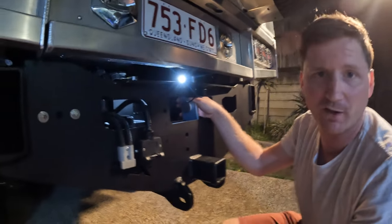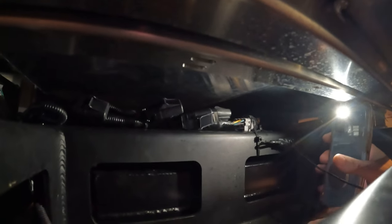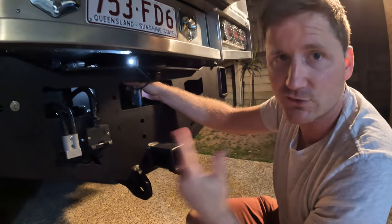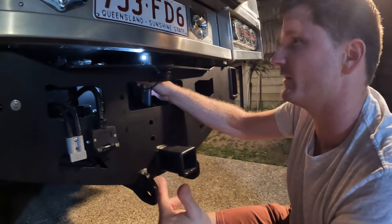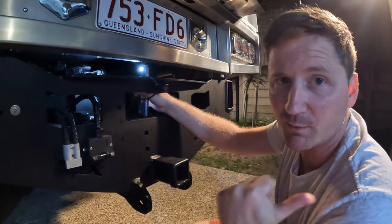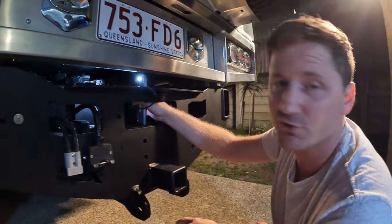There's the Anderson plug as well, which I put in at the same time while we were working there. And up in here - I don't know if you can see it in the dark - but these are all the fuses, and they're all relevant to the trailer plug harness. There's a fuse for your clearance lights, your indicators, your stop, and your tail lights. So it's a fuse for each of the lights that go back to the caravan - if you have any problems on the van, it doesn't blow the car lights, it'll just blow those fuses and you can troubleshoot what's going on.